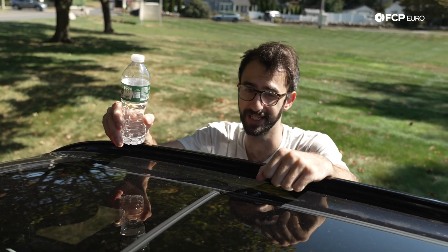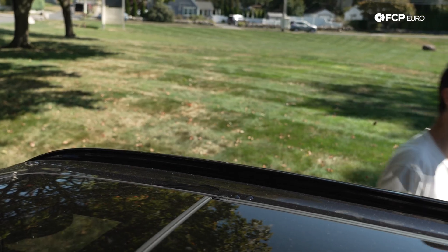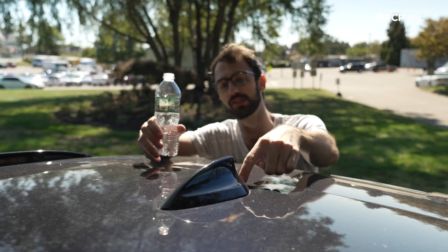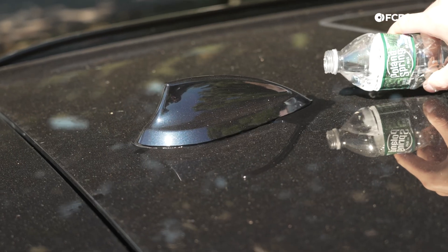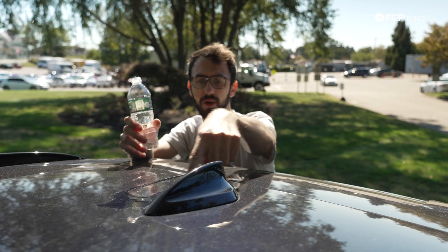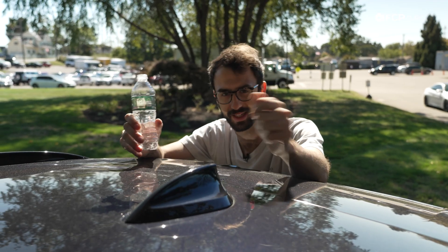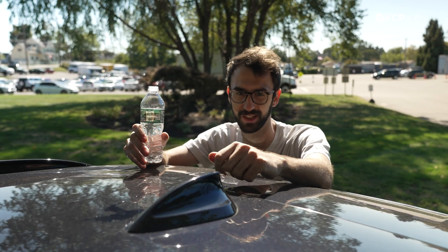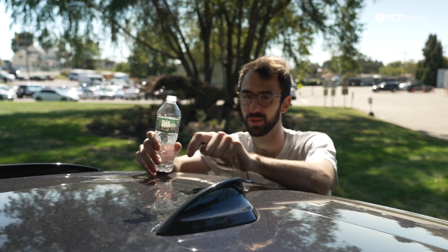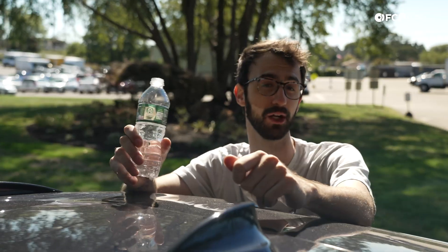Unfortunately, there's a third thing that happens that is the plague of a lot of modern cars. Back here on the rear of the car, we have this shark fin antenna, and as you can see, there's a small little moat around it. If I pour water in it, you'll see that water collects right around the shark fin antenna. Now these are typically bonded to the roof with something like a windshield adhesive, and unfortunately that shrinks and goes bad. So be sure to check this because these don't have a drain, and if water is getting in here, you can kiss all of your roof function centers and your telematics modules goodbye.